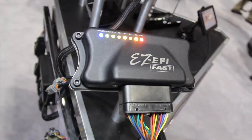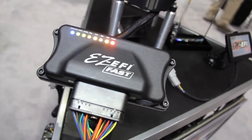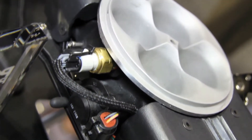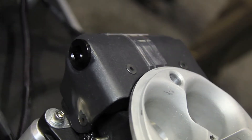I want to know some of the components of this system — give me a rundown of what guys are going to get in the package. The basis of it is a throttle body, which is the piece that replaces the carburetor. Instead of traditional carburetor technology, it has electronic fuel injectors mounted inside the unit in a really attractive package that's actually an enhancement to the looks of the engine, as well as offering performance benefits. All the sensors needed — except for the oxygen sensor — are integrated into this one piece, making for a simple, clean installation.